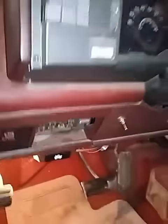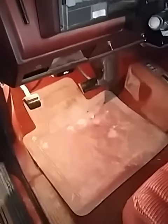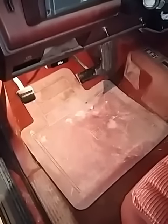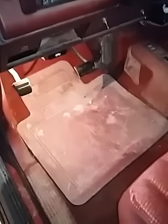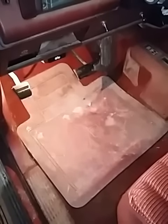The first thing you want to check is your fuse. It's located right up in here by your left knee, just above the hood release button, and it's marked 'four-wheel drive' — it's a 25-amp fuse. Pull that out. If it's blown, there's a reason why that happened, so you don't want to put a new fuse in right away because chances are it'll just blow again.